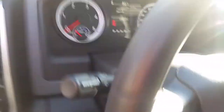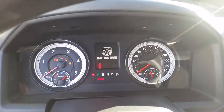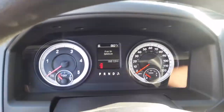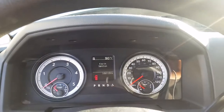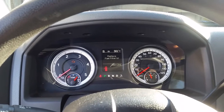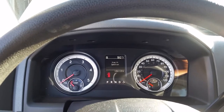What I'm gonna do right now, since everything's good already, is turn the key on one time, let the diesel pump, turn it off, let it chill a little bit, turn the key on again. I will probably have to do it 3 times for my years of experience. At least 3 times. Maybe 5. So all the diesel will pump up correctly.